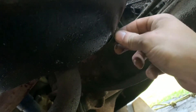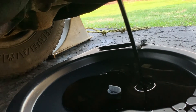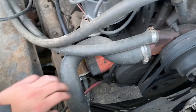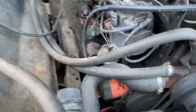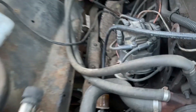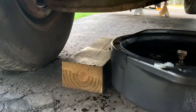Okay guys, I know it's dark down here, but this is the drain bolt right here. I cracked it already with my 9/16ths ratchet. And there she comes, going down into the pan. That's starting to slow down to like a drip now. The oil filter is not exactly hard to get to or reach. You have a lot of room right here. Oil filter wrenches can reach around that thing and grab it nicely. It can be a pain — you can use a big pair of channel locks — but other than that it should come off pretty easily.